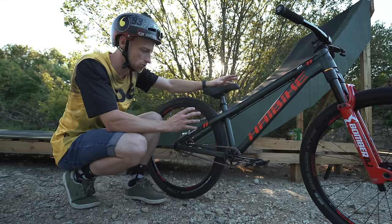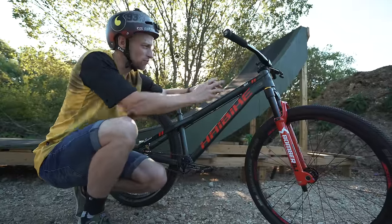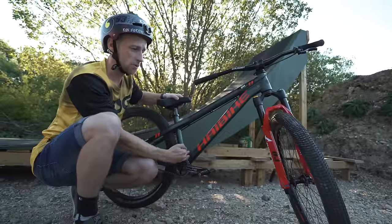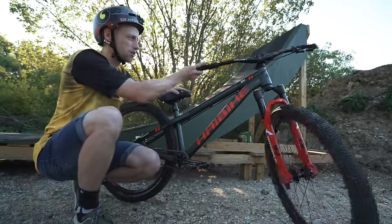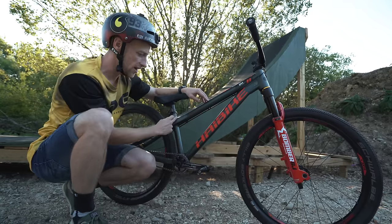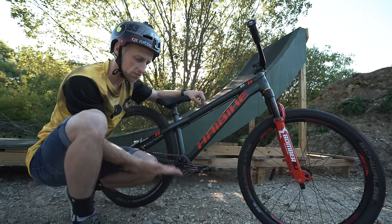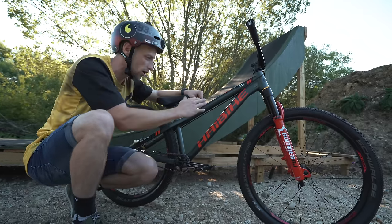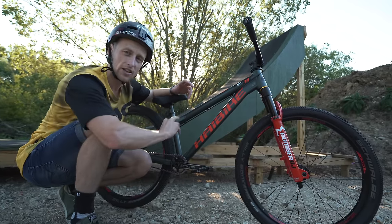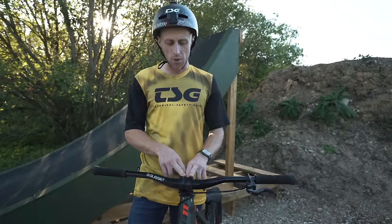You do compromise a little stability, but having a shorter bike just makes all your tricks so much easier. You want the same feeling at the front, but you can only make it so short before your handlebars and wheel would start interfering in this area, which is bad for tricks like tail whips and bar spins. The way you achieve that feeling up front without changing the length is by raising the bottom bracket and steepening the head tube — that lifts your feet up and pushes the handlebars underneath you, making it feel shorter by adjusting the position of those two objects.